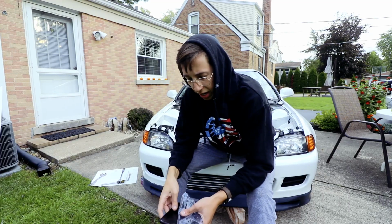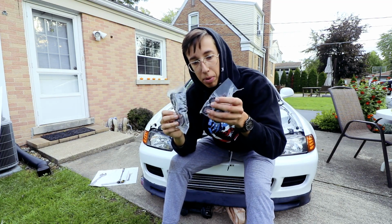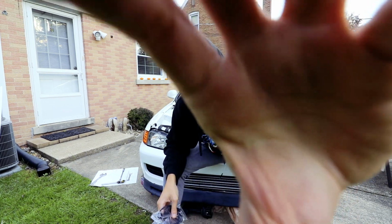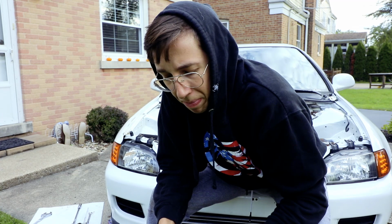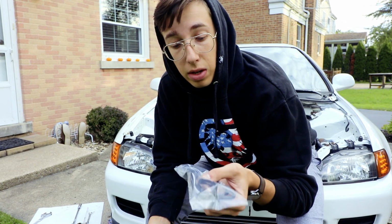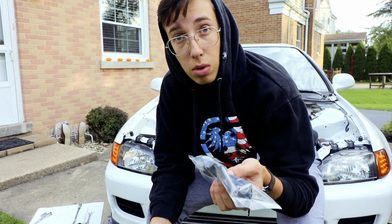All right, we're back, and I got the actual Honda OEM parts this time. I got an OEM gasket, and you know what the coolest thing is? Hold on, bring it in. I was told that those crappy Felpro ones that you buy at NAPA and stuff, and this is true, I've actually experienced this, but I thought it was common with all of these valve cover gaskets. But those Felpro ones, when they heat up, they stretch when you take them off. So if you take the valve cover off, it breaks, you gotta find a new gasket, it also won't fit back on.